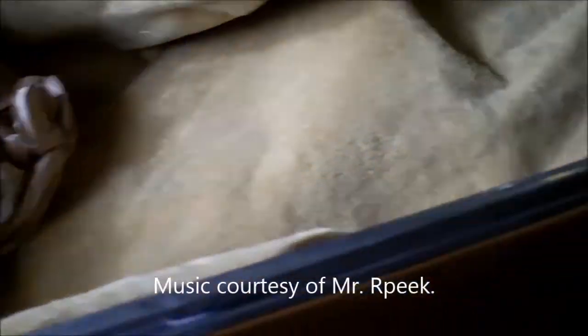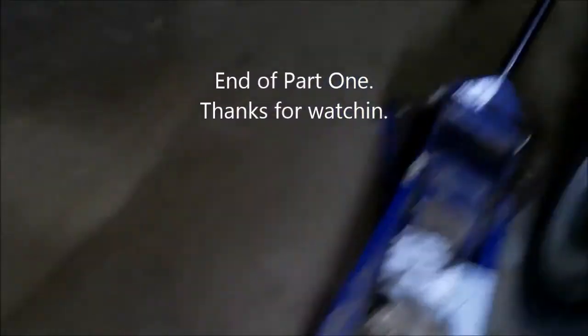Anyway, here's the passenger seat. Here's the carpet — it's all wadded up now since we had to yank it out of there to get the seats in. We put the air cleaner back on it, so now it actually runs better. I'm hoping that's all that was wrong with it, but we're also hoping the choke is the reason why it wasn't running smoothly. It's running smoother now than it was before, but that's only because we put the air cleaner back on it.